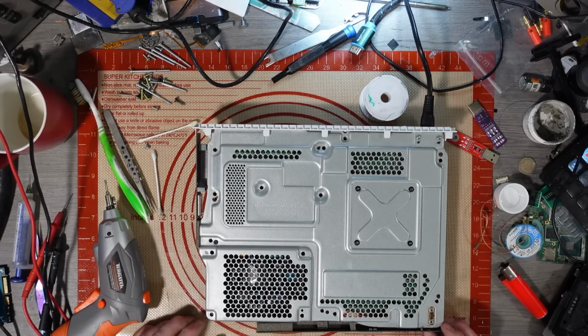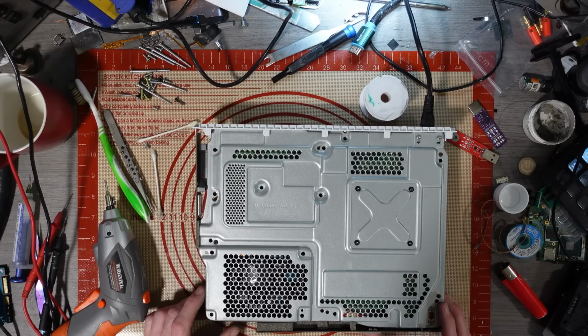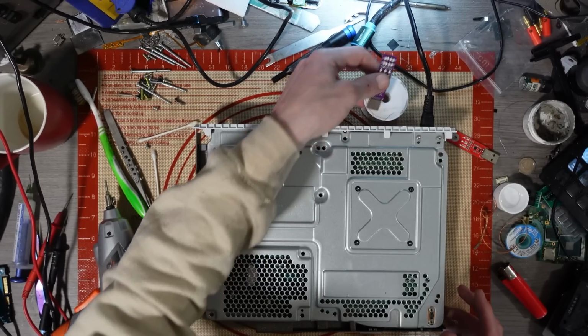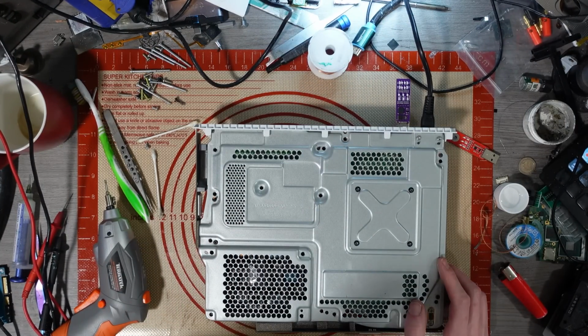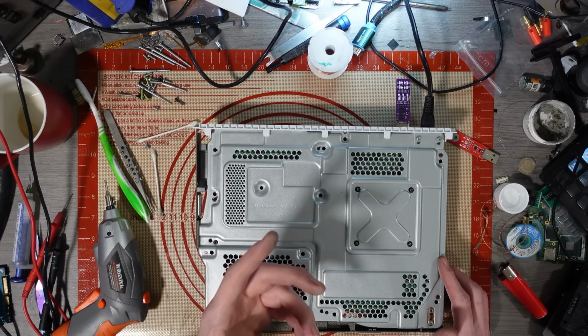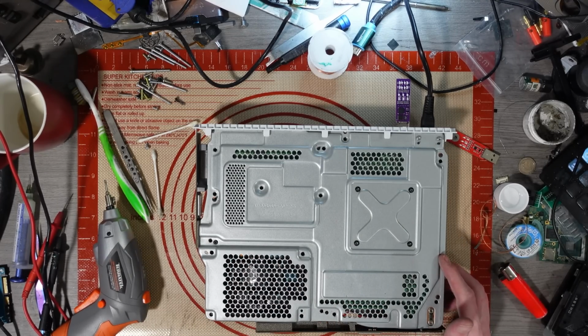Yeah, that hard drive's dead. I can hear the hard drive trying to spin up. It's definitely dead. But let's just see if this works. It's probably not going to work because it's not actually going to activate the HDMI signal until it detects a hard drive, which is why it shuts down after 30 seconds. So yeah, I'm going to need to put a hard drive in.